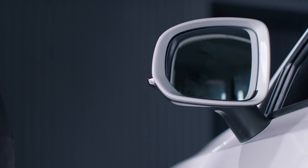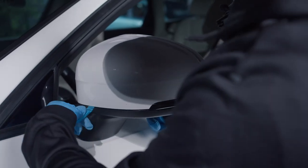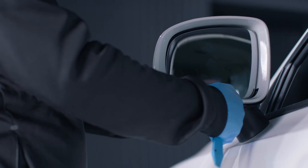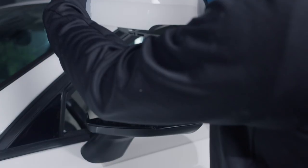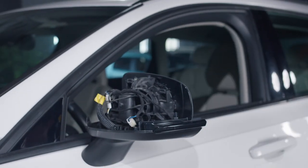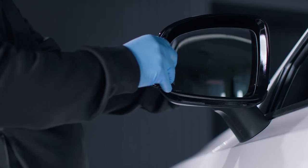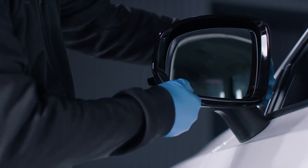So let's start. Take the tool from the demounting kit and pry it under the frame of the wing mirror cover. You can also take one tool to open it in the front. Once you've done that, wiggle a bit to get it loosened and at the same time drag it upwards. To mount the new one, slowly put it down on the wing mirror, find the place of all the clips, and you will hear it click when it's in place.